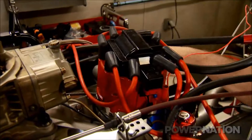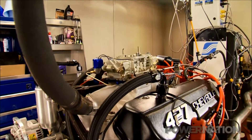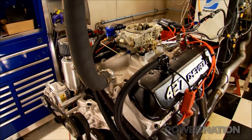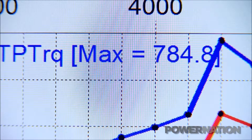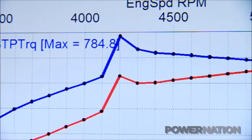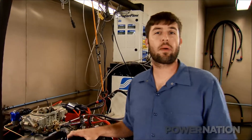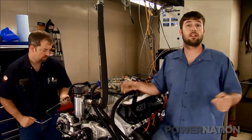Let's tune on a little bit more. Keep the same shot and add some timing — we definitely got enough octane to do it now. 669 horsepower, 784 foot-pounds of torque. Look how much power it carries through the midrange and it doesn't drop. We made 200 horsepower over the baseline in crate form with our little 427 — that was with a 150 shot of nitrous and our Race Gas, which let us keep the timing in it. The air fuels look great, telling us it worked.